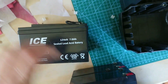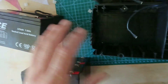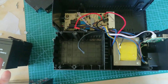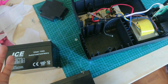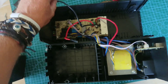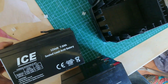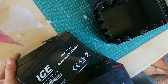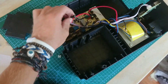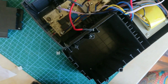Okay, got the old batteries out. They're stuck together — just connected in series, two 12-volt batteries in series. Very easy to replace. A lot of people throw these UPSs out because they stop working and then buy new ones for 1000-and-something rand, when you can just replace the batteries very easily and they work again. These batteries are now going for 250 rand each, up from 189 rand not very long ago. You just plop them in — they literally just clip onto the terminals. Very straightforward.